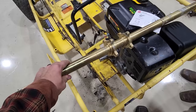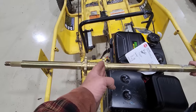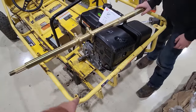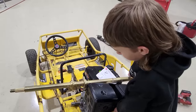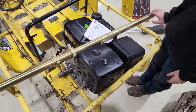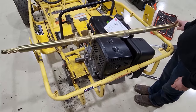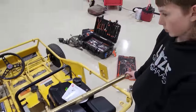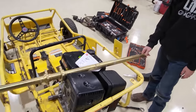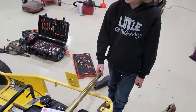engine. Yeah, because if this is something like that, brakes and sprocket, that's going to have to be aligned with the clutch. So you've got to move your motor mount plate over, don't you? Yeah. So all this needs to be cut out and we have to make a different plate. And we should probably get the other axle in first. Yeah. So we see what we've got and start mocking stuff in. But the good news is, you might not have to move your seat bracket. Yeah, it's going to be tight.